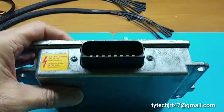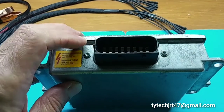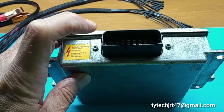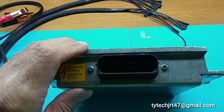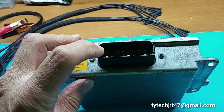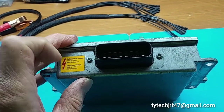The connector on the unit, which is a 16-pin connector, is the identical connector that's used on the two coil packs. So you have three identical connectors. Of course the pin outs are different, but this connector is pretty much universal in the ignition system. Both coil packs and the voltage transformer use the same exact connector.